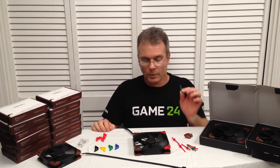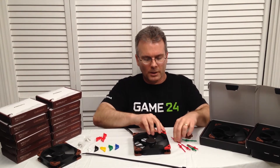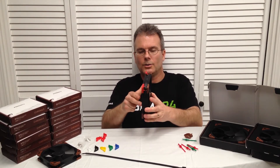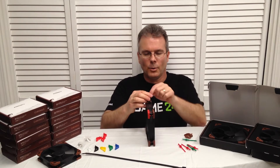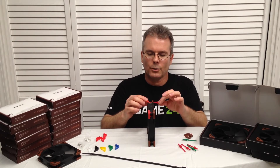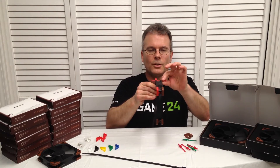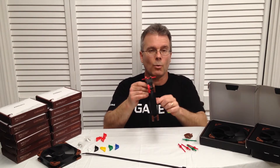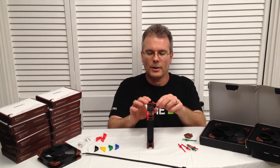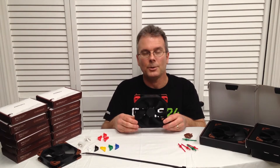We also have these little anti-vibration mounts, and these are really nice. The fans come with your standard screws to mount them in a case, but these are a great alternative. The way they work is if you're going to mount your fan as an exhaust fan in your case — so that it is pushing air in one direction — you mount it against the back of your case. You take these little guys and you fish one through here, pull it, it pops in, and then you fish it through the hole in the case and pull it through. You do that to all four corners, and you have a very quick, convenient way to mount these fans with the added benefit of anti-vibration.